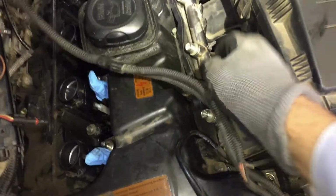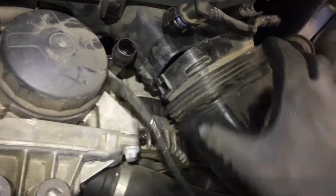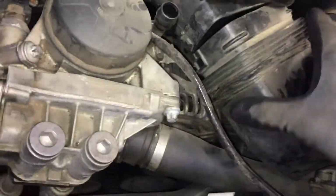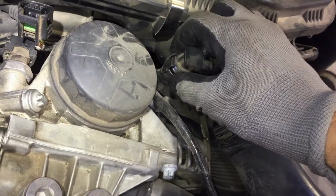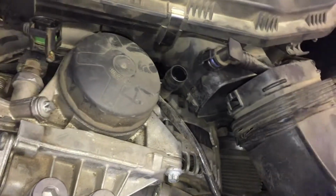Okay, YouTubers, I tried to pull it on, it wouldn't come out, so I went ahead and loosened the rail. You don't have to take it all the way out, but if you're afraid you're gonna break it right there, look right there where it bends, then disconnect it from here. But I got enough clearance now to move this, and I had to pull this box off. So what you do is you just unhook it from here, take a screwdriver, so I'm gonna open this up and it'll unhook from here. And then this line, you're supposed to have two clips on the side. This only has one. Pinch it and pop it open. If you can't, stick something on the sides and open those ears and pop it open.